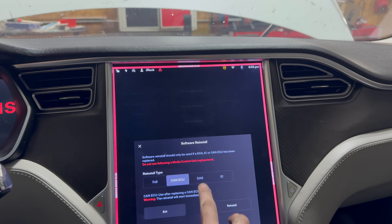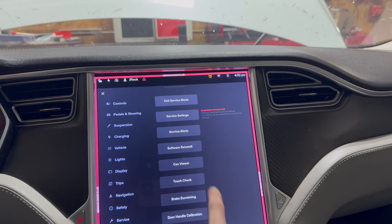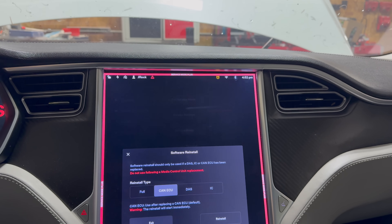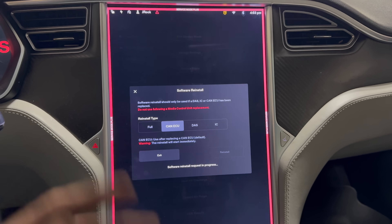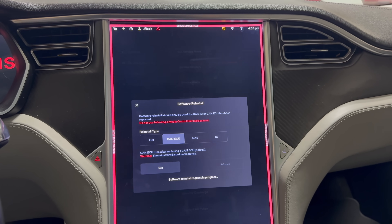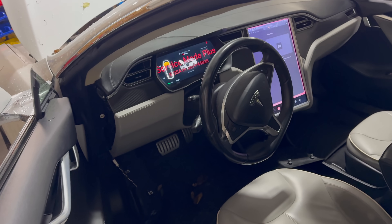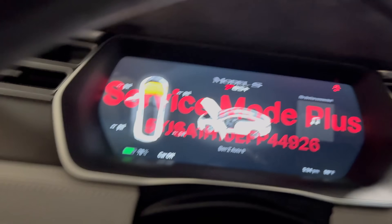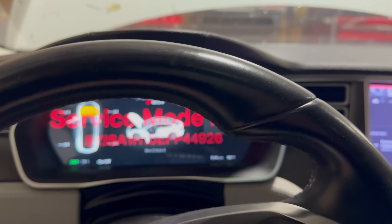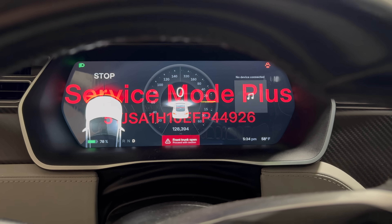Let's go ahead and start with a software reinstall. We are connected to our Wi-Fi here. We'll go ahead and hit reinstall and let that go through its process — it'll probably take 15 to 20 minutes. The car has now completed its firmware redeploy. I actually just did a full software update on it. It still says P85+, but we no longer get complaints for a firmware mismatch. If I put my foot on the brake, the car is on, and we can put it into gear. Awesome.